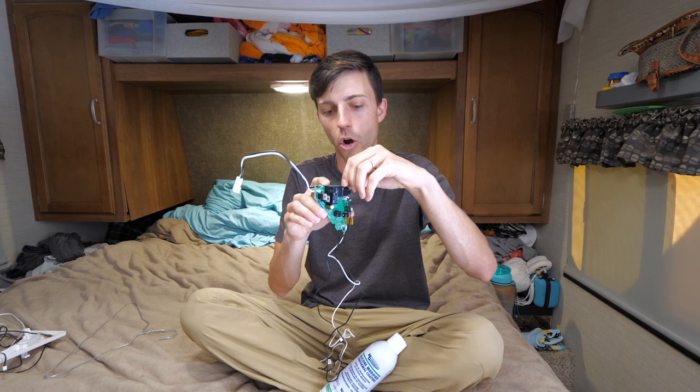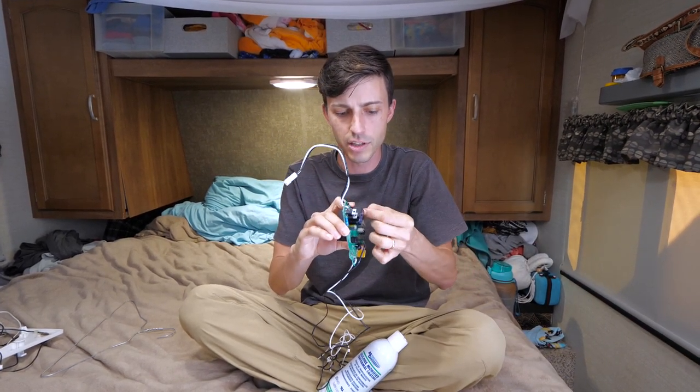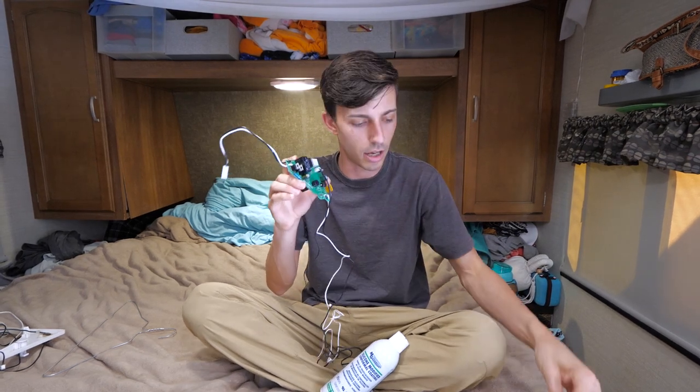And it's also really important that you guys mask off these openings for other sensor inputs. And I don't have any masking tape, so I just used electrical tape, but whatever, it all works just fine. So I can go ahead and remove my tape now, and it's insanely important that you remember this right here to mask off. These are the pins for the button board. So these have to be able to still conduct electricity. Otherwise, you basically just killed your board.